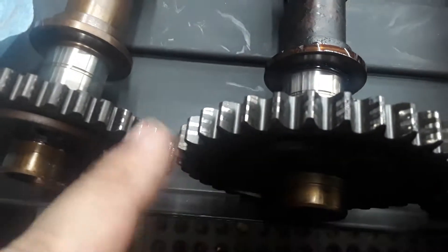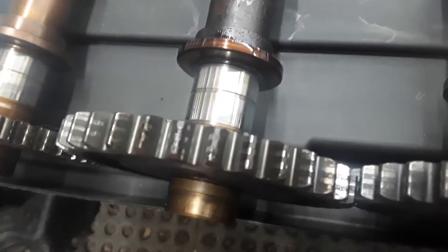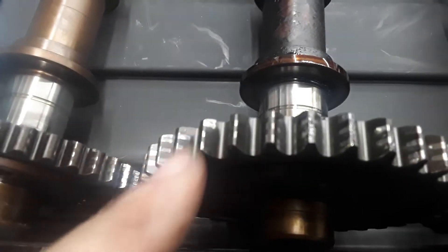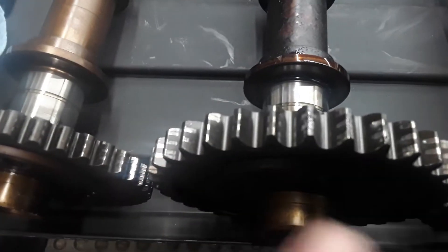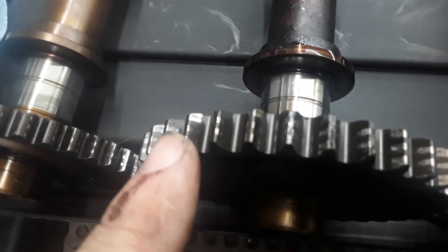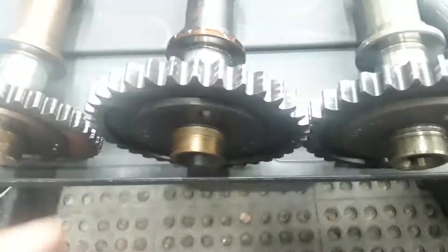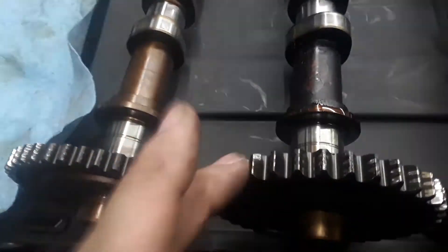This one has marks in it, because when the engine goes around, the chain only hits the same exact tooth in the same exact spot over and over again. That's why it always alternates — 3, 2, 3, 2, 3, 2 — as I count the marks on each of these. Because they don't alternate, they all leave that same mark on each single tooth of this cam. The thing to do when you put these back in is alternate the chain. Where this tooth has three wear marks and this one has two, put the chain link that contacts three teeth here and the one with two here. It'll help keep your chain snug around all these gears and eliminate any cam slop between the sprockets and the chains.